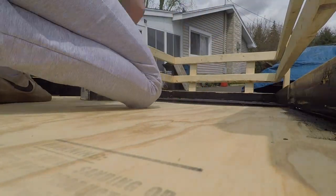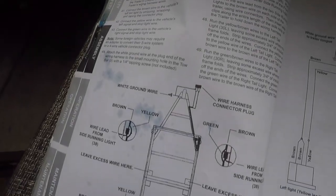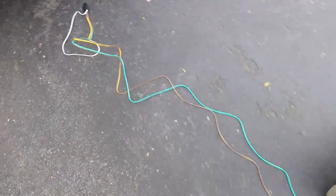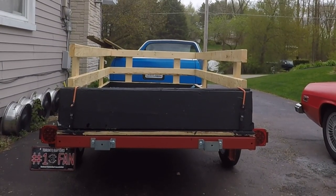Finally, I needed to set up the lights. I hate doing electrical work, but it was very straightforward. The kit even includes a wiring harness if your vehicle isn't already set up with one. Just line up the wires by color, crimp for the side lights, and use the provided clips to run the wire down the inside of the frame, before stripping and capping with the rear lights — and they worked.